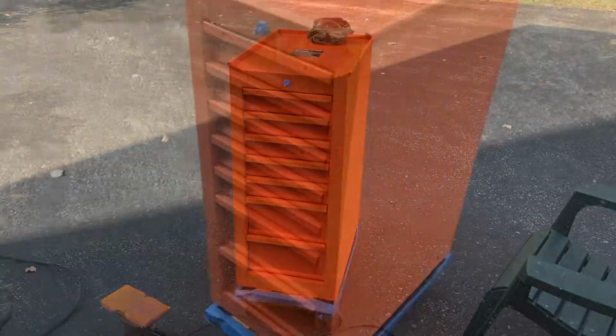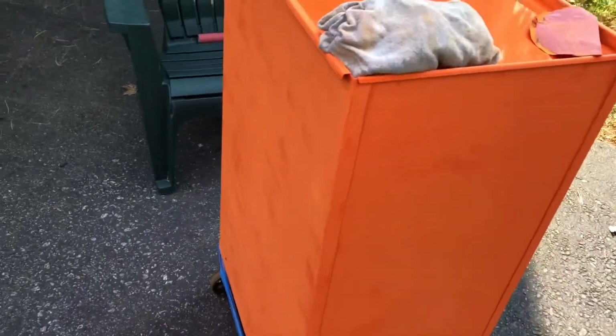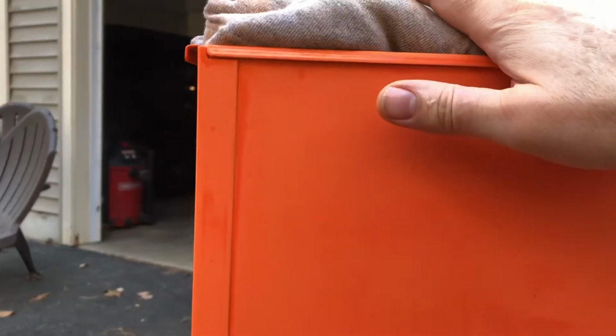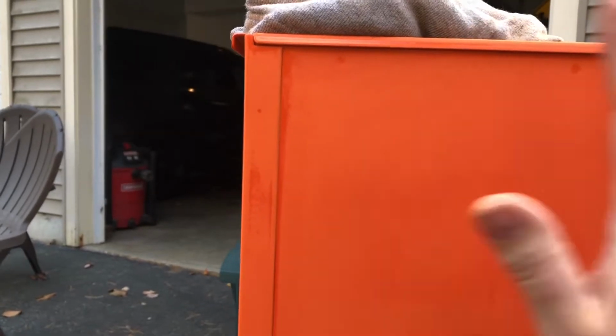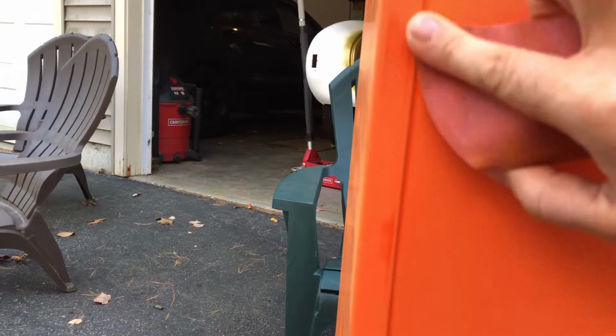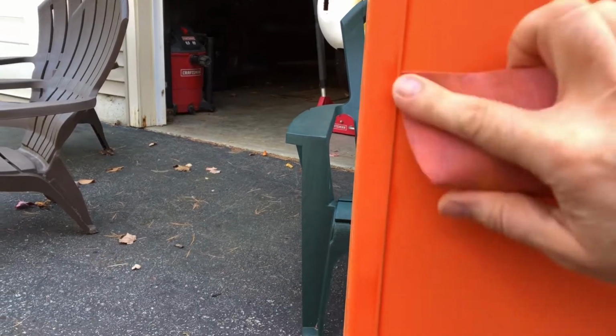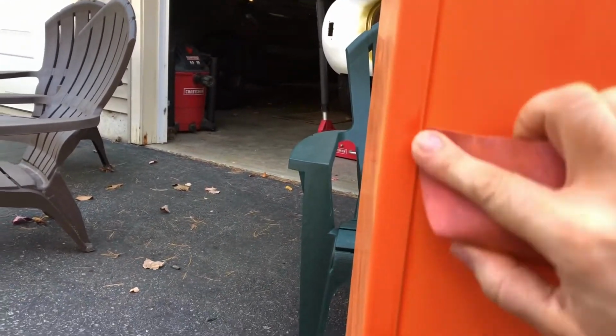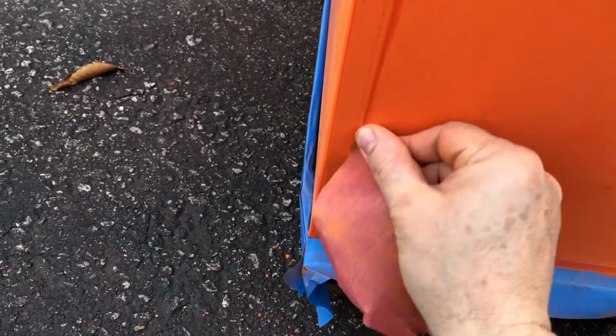So we'll see. So we're just about ready for paint. We got most of the sanding done, all of the sanding done. So you want to dry clean, go over it with a clean rag. Dry clean all the dust off first. Then you're going to wet clean it with rubbing alcohol or glass cleaner or something like that. But we're looking for shiny spots here, like along this edge. Now this is the back, so it's not really super critical.